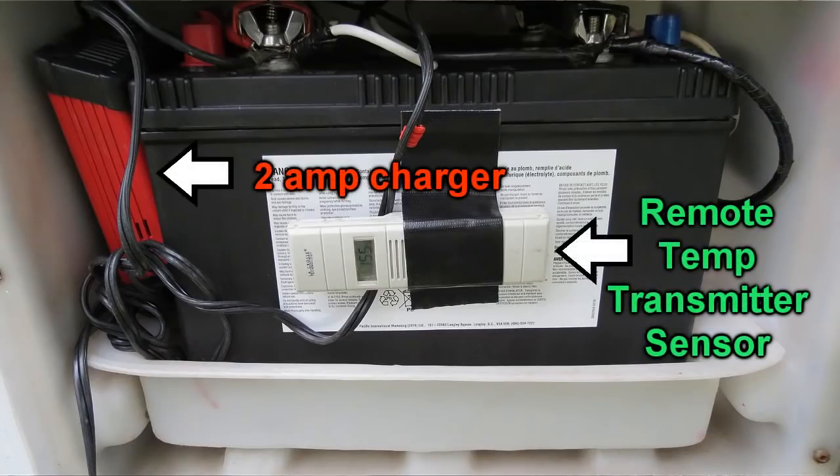I've got a Go Power system with power going all sorts of places, and you need to keep track of that. Do not mismatch those wires. I tell you this because I crossed my wires once for a brief second in a parking lot in Bellingham, Washington when replacing a battery, and it fried my onboard charger. I just replaced it with a Walmart charger — that little red charger you see in the battery bank. Today when I installed these batteries I photographed all the terminal connections to make sure every wire was in the correct place — no mystery, no guessing, no accidents.